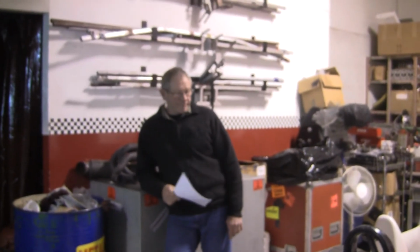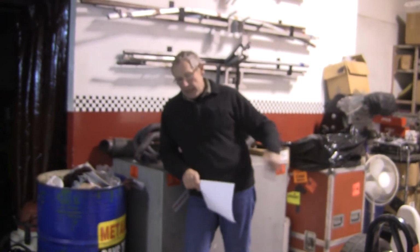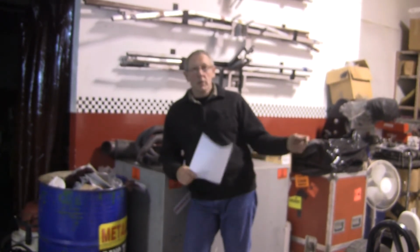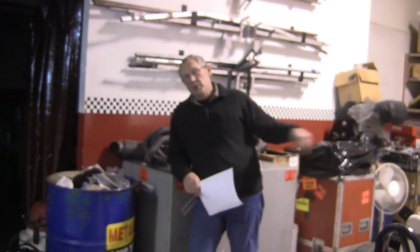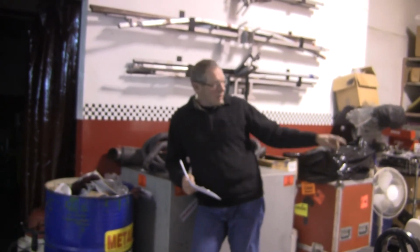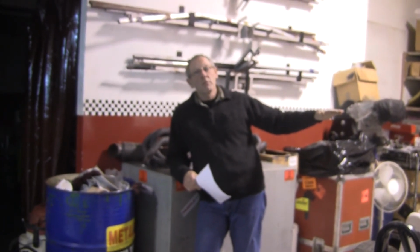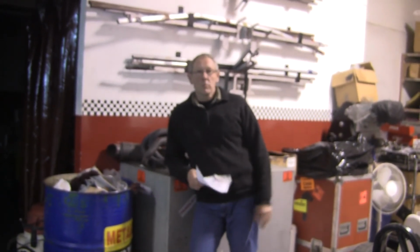Well, I'll let you into a little secret. We've got a set of corner weight scales in that box there, and when we set a car up on this pad here, unless there's a dead shock or a duff spring, the corner weight scales go under the car, and you look at it and you go, okay, we'll put those away, because you don't actually need them. Because if you are pedantic about the measurements you take and levelling the car the way this says, and then lifting the back of the car in the middle like a 3-legged chair, and then adjusting the rear push rod so that when the car comes down both wheels touch the ground at the same time, you've got a 4-legged chair that is not going to rock, and therefore the problem's over.